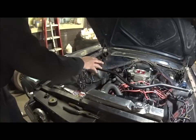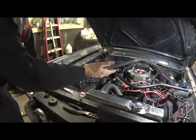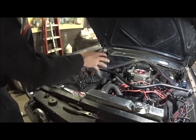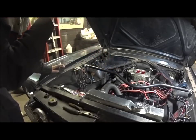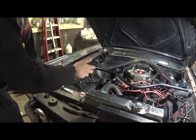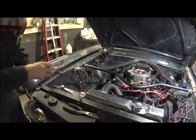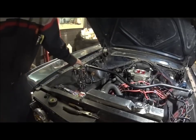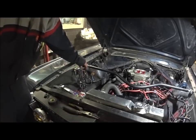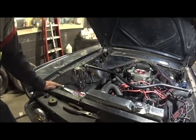This is all the wiring for that system — fuses and such, taped into a loom and taped off to the side. The fuel pump is driven by a relay. You really don't want to run the fuel pump directly off the driver in the PCM. There's an output that will kick a relay on, so what makes sense is to add a relay into the circuit. If you do have a problem, I would prefer that relay takes the brunt of it — and the fuse it's attached to — rather than the computer control inside the throttle body.